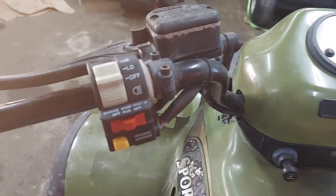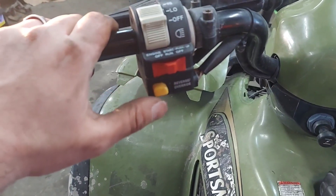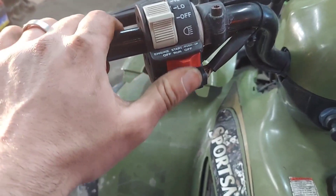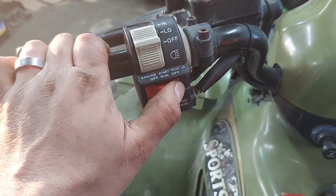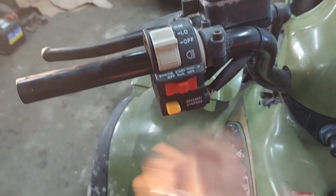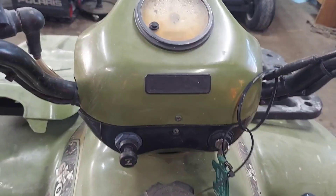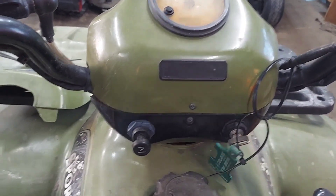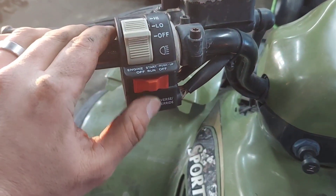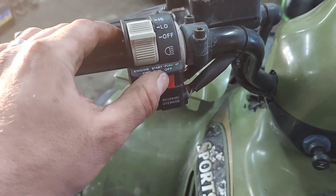Back on. I'm going to see right now for the first time. Turn the key on. It's still pretty sensitive. Fires right up, though. Let's try it again — key on, the fan should run. But it's not, unless I mess with it, unless I touch that. So it's still not making good contact.